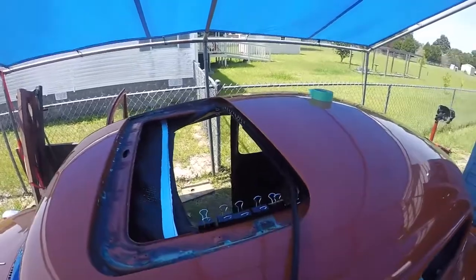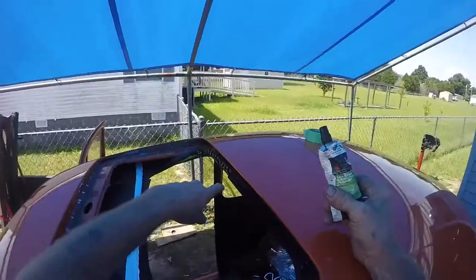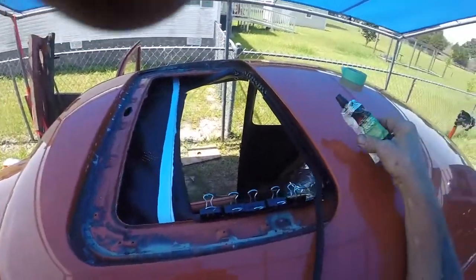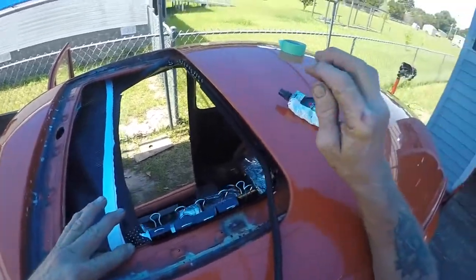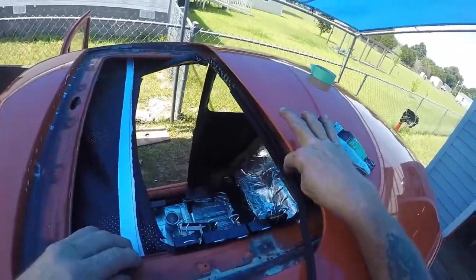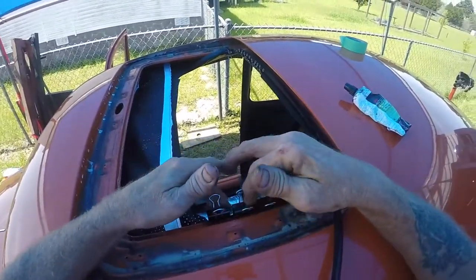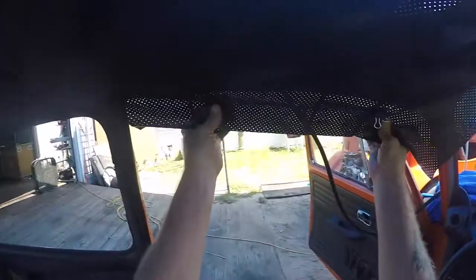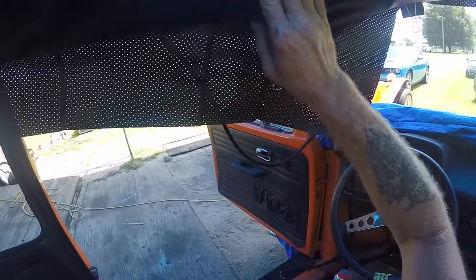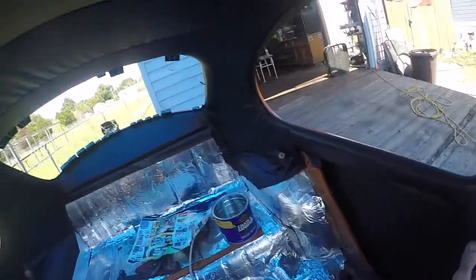All right guys, I finally made it to the back of the sunroof. I put clips all the way across. I didn't use spray glue — can't spray directly into that trough — so I used black super weather gasket adhesive and put it right in the trough, staying on top of the edge and letting it run down on the inside. That way it's stuck on both the top and inside. I made sure it wasn't puddling where the seal wouldn't fit. I'll take a little razor blade and trim the area. I'm tucking the fabric into the groove — I still have excess up here but I'll glue this section first.